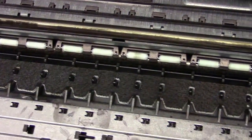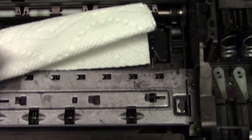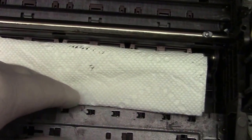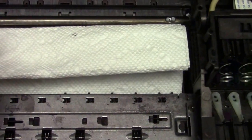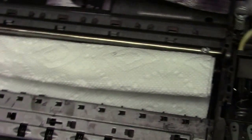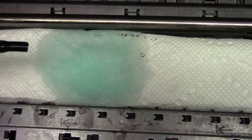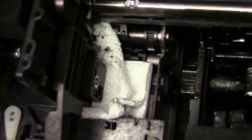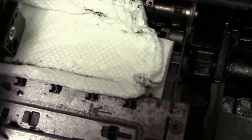Get a piece of paper towel, fold it up, and lay it right in there, then pull the printhead over it. I've folded it up quite a few times because I want to lay it right down in there. In the center, wet that paper towel with the blue lightning, then slide the printhead over the top. Put it down on there — get it really heavy. Once I get it under that printhead, I'll slide it over and keep going until it comes right on over that spot.